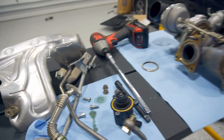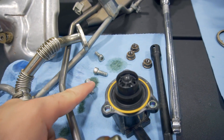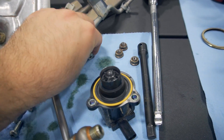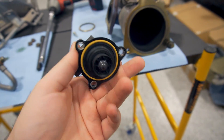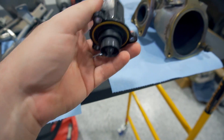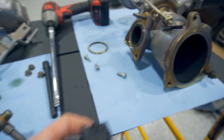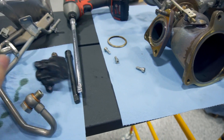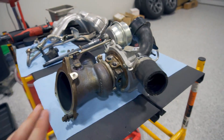You are not going to reuse the factory nuts. If you're installing a blow-off valve — which you should — you can reuse these bolts here. I'm going to reuse the factory diverter valve for now and add a Go Fast Bits VTA from our website, going in between, just to see what we can get away with using all the factory hardware.